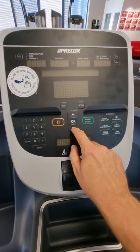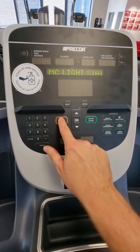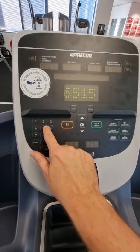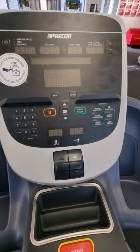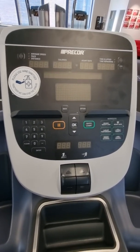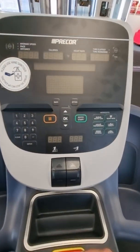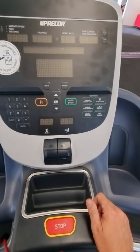Hit the back button and scroll through to other various settings. Again on this you'll have the same club settings as well. Hit pause 5-6-5-1-5-6-5, which is a shortened version of what you can do in the technician's settings. The technician's mode at 5-1-7-6-5-7-6-1 will give you everything you can change, whereas 5-6-5-1-5-6-5 is just a few variations in the buttons you can press — you can't do everything in club mode that you can in technician's mode.